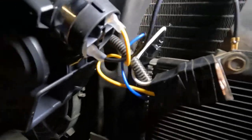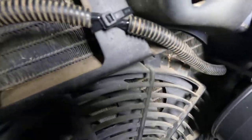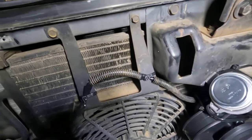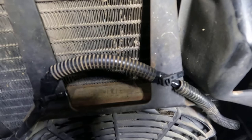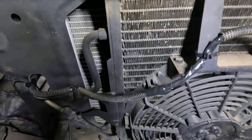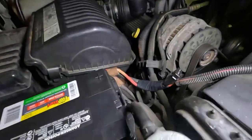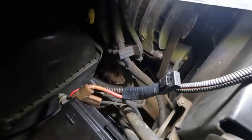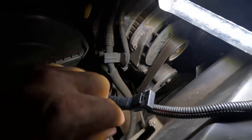The way I ran that wire — I put it in some wiring loom and went across behind the horn right there, then across on top of the fan, using zip ties and tape to secure it. I put the tape around the wire to give it extra protection from ever rubbing anything. I ran it on around through where the condenser lines go through the front, and it comes back out there. I ran the wire up here, put some wiring loom on it, taped it up, and it does have a 30 amp fuse right there.